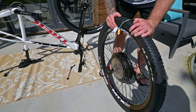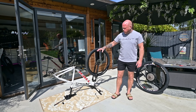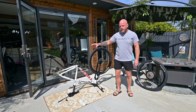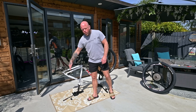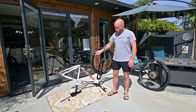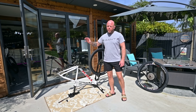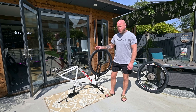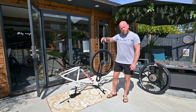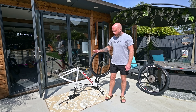That's absolutely amazing — I never thought you'd get a 12 speed on a 2000 watt hub wheel. Hopefully we can get a legit 12-by-1 speed setup. Now comes the fun part of getting this on the bike. I like to fit the wheel on upside down so gravity helps the dropouts drop in. I didn't want to put that massive battery in before flipping it over, so I'll get the wheel on first, flip it back over, then fit the battery and make a decision on the controller.